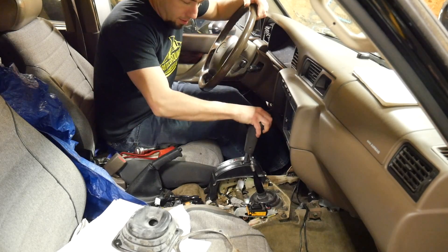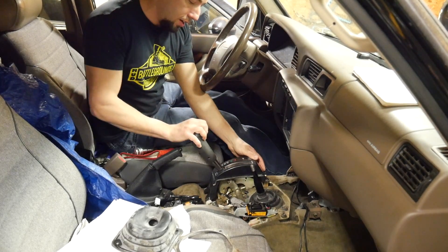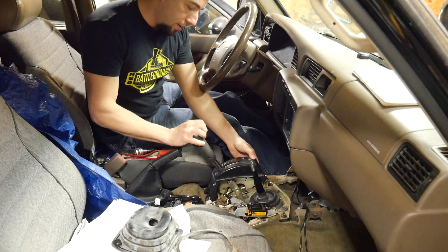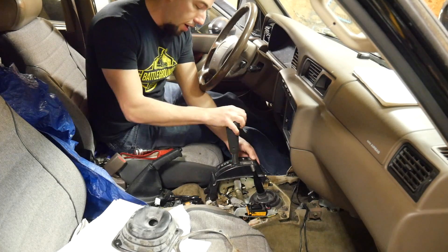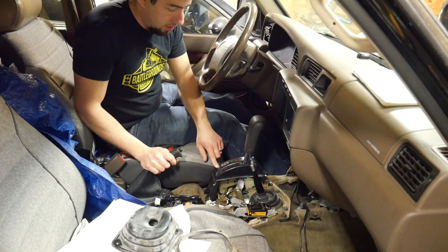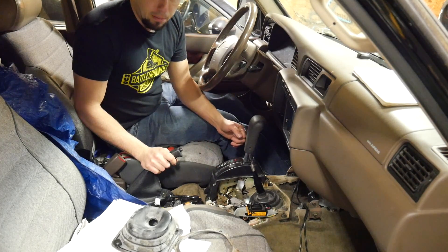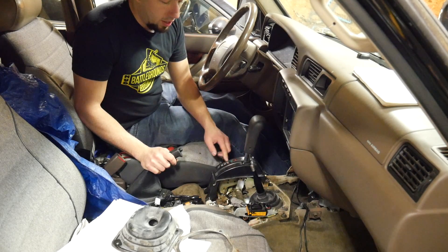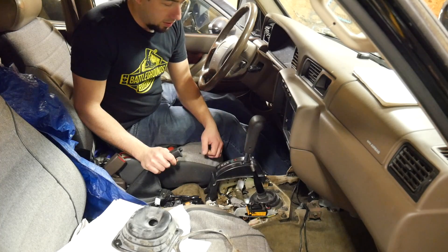We're going to go inside and see how this feels. I have to press the shift to the left — it feels awesome. The lower detents are a little off, but there's not really much I can do about that; it's just the spacing in the shifter. If it becomes a problem once this is all put together I'll probably address it. Park through drive is good, and I can use tap shift to select gear once this is all installed anyway.